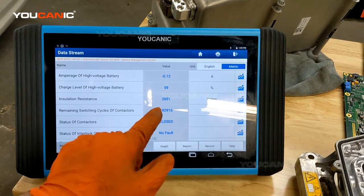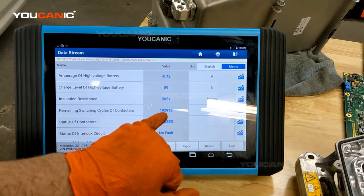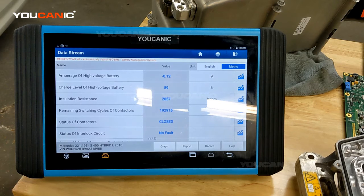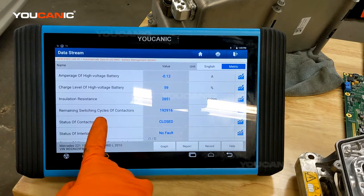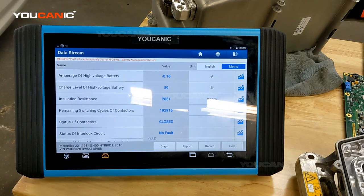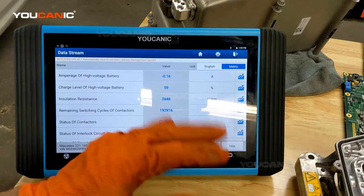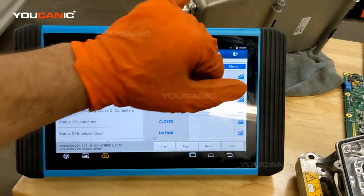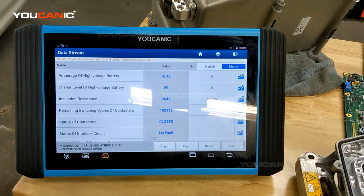In this case there are still a lot of cycles left, and that number is counting down. There was another vehicle — shipped from Connecticut to Baltimore — where we diagnosed it and on that hybrid battery the remaining switch cycles of the contactors was down to zero. What that means is the hardware inside, called the BMS — Battery Management System — which manages the voltage of the battery, the operation of the contactors on and off, temperature, and many other things, is saying that once it reaches zero, that battery can no longer function or be operational.